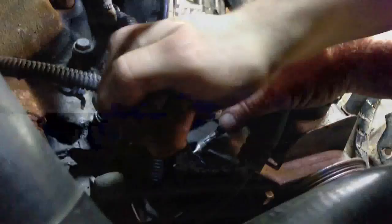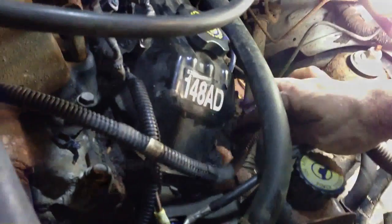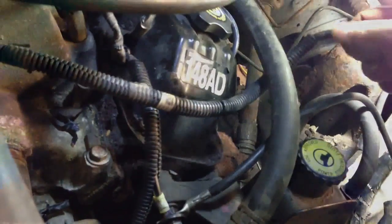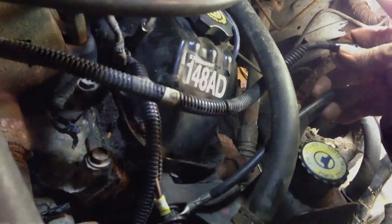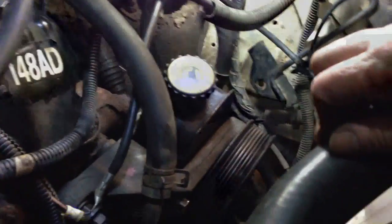Okay, we've got the two wires on there now. We're just going to hold that terminal straight so it doesn't pull, and Mike will tighten that right down. It always pays to have nice tools — that flat ratchet, I've had that one for probably 35 or 40 years and it still works. Now this is an alternator wire — generally I wouldn't want to have the two of them tight together. You don't want to have a positive and a negative right close together in case they rub on each other. So all the other bolts are tightened up.